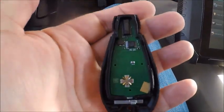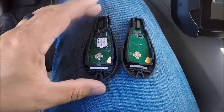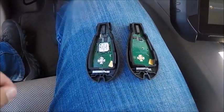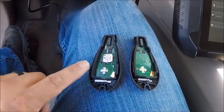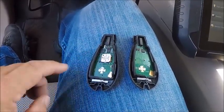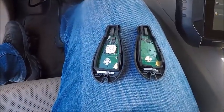And here is just a plain standard fob. So make sure when you're doing the keyless-to-go and you're having issues matching your keyless-to-go or programming your proximity function, double check — open it up and make sure your fob has that copper coil inside, make sure it all looks intact, and make sure you've got a quality battery in there.